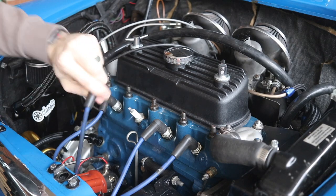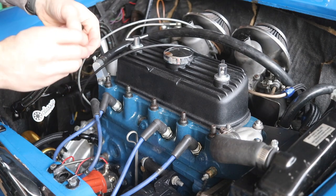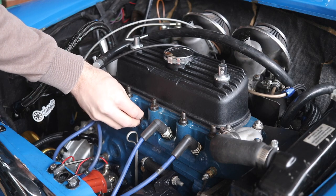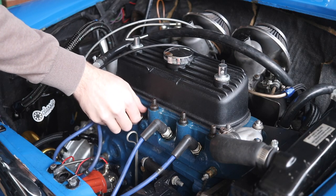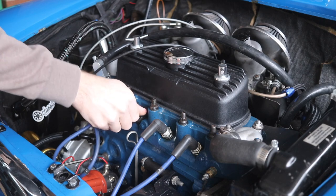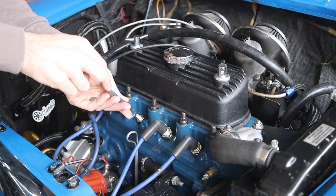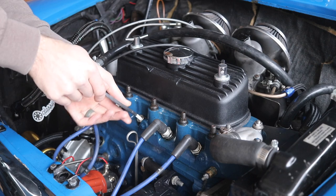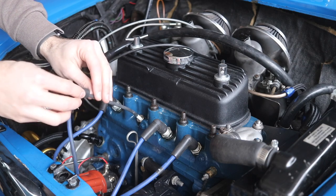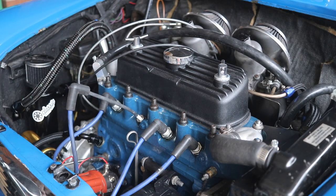Let's pop this off. Keep in mind that stuff's probably going to be hot. Gunson actually says specifically that this can go on basically finger tight — it does not need to go on gorilla tight into this head, because it should make an adequate seal with just your fingers tightening this down. It has a little adapter here so you can slide that over it and it'll help you screw it in and get it nice and tight. That is adequately tight on there, and as you can see it looks a lot different than your normal spark plug. Take this lead extension and screw that onto the lead on your Color Tune, then with this lead here you just want to make sure it's getting metal contact — this is not going to sit on there really tight, you just want all of the metal lead to contact so it actually fires inside that cylinder.